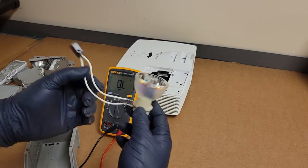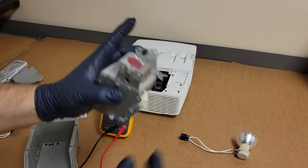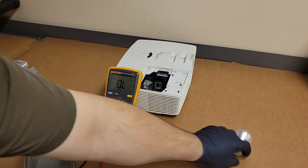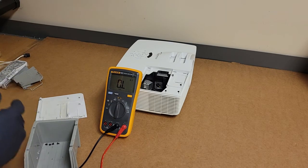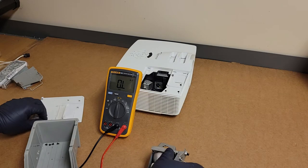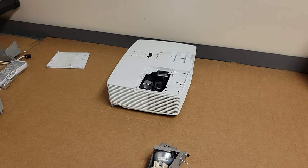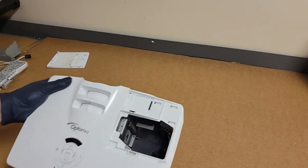I tested this one on my test box and it lit up beautifully — no problems there. I am not going to plug in either of these cheap lamps; I don't trust them. At least one of them is going to get this bulb reinstalled. But for now we're going to use this one which I know is good — it's out of my other HD26. Before we even do that, I want to make sure the whole thing comes on, so we're going to bypass the door switch and power it up without a lamp. I want to see the color wheel spin.